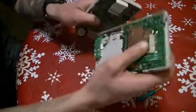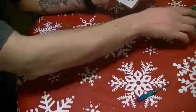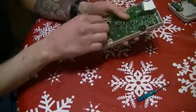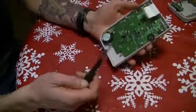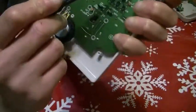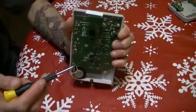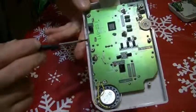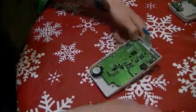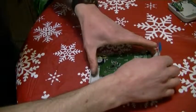When you're prying this apart, be careful — there's a ribbon that gets attached to this piece right here, so pull on it gently. Then move it to the side unless you want to clean it. There's only four screws on that inner piece — you can take it apart and get inside the cartridge holder. Now grab your Phillips head double-zero screwdriver. You can see these white circles — that's where all the screws go, ten screws altogether. Remove all ten, be gentle pulling it apart, and be careful with the speaker too.